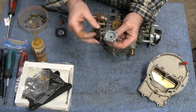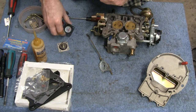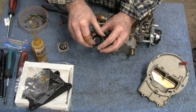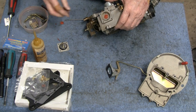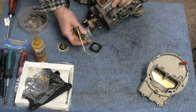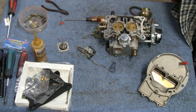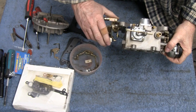Here's our accelerator pump. The newer one is a little different — it's a two-piece design instead of just one piece. I think this small piece goes in first, then the pump body. Before putting that in, we've got to put this little spring in. I shut the camera off so I could sit down, relax, and not worry about shooting that spring across the garage. Got it in there and it seems to be working fine.